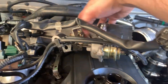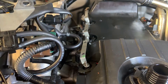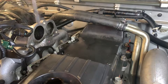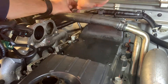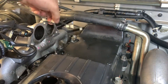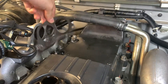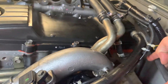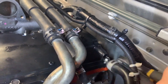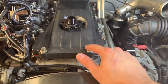Don't lose your hose clamp and I'm just going to tuck it to the side for now. So you just have to take the other three bolts to hold the rail on and then after that just the breather at the back and then we'll start undoing all the bolts. So just like that the rail should pop off. Also don't forget your gasket that goes on here - later on we're going to put that back on. I'm just going to grab this breather back here as well. So essentially now these are just 12 mils all the way around.